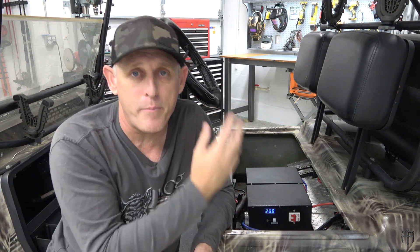I took it back, fully charged it, and noticed something: one of my battery packs was charging to about 33 volts while the other was only charging to about 25 to 26 volts. The main charger would shut off, so the lower voltage box would never come up to equal the other. Once the high box hit 33 volts, the smart charger thought both boxes were fully charged and stopped charging.